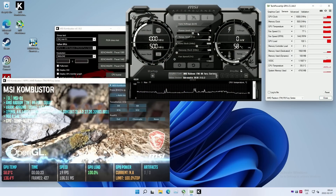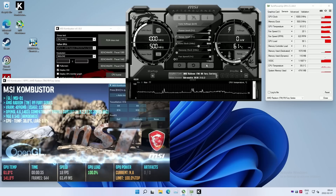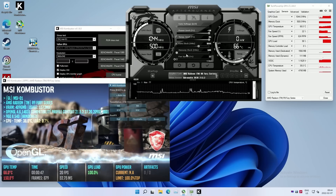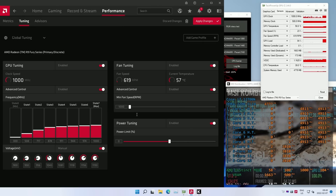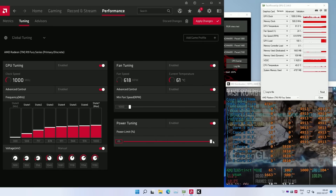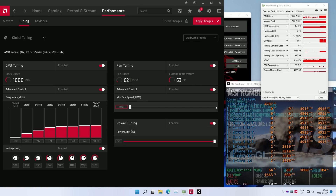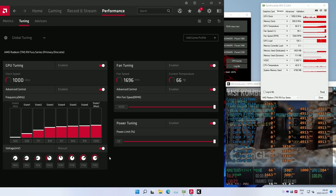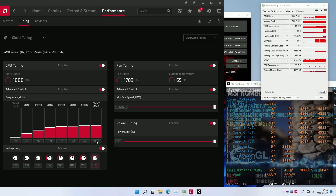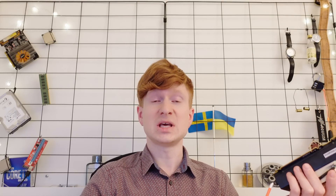Overclocking is another interesting subject that most of you are probably interested in. Unfortunately this AMD Radeon Instinct MI8 behaves exactly the same as the R9 Nano, which means overclocking headroom is very limited. It is also not possible to overclock the HBM memory or adjust the voltage of the HBM memory. In general, I would just say plug it in and let it work on the default settings — that is the best way. You can try to squeeze out a little more MHz on the GPU core and slightly reduce the voltage for better efficiency, but gaming performance is almost unaffected by these manipulations.